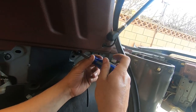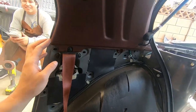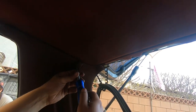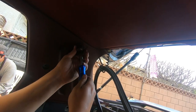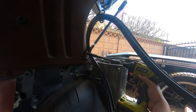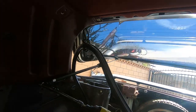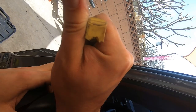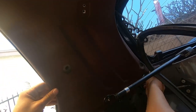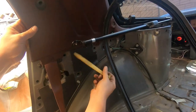B pillars — remove the two screws on the bottom. Make sure you have that seat belt up top already removed, and then there's going to be a coat hanger kind of hook up top that you can remove with the screwdriver. You'll also need to remove the shock for the hatch, but make sure you have something propping it up. Same plastic trim removal process — find where it snapped into the car and pull from there. It's easier than the A pillar, and I don't think I broke any of my tabs on either side.